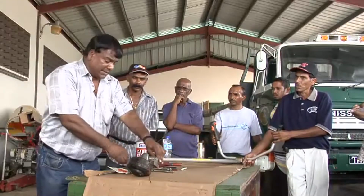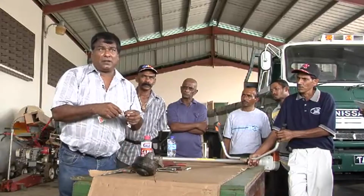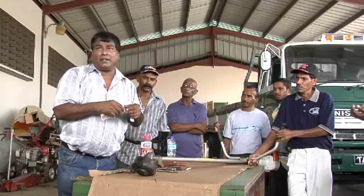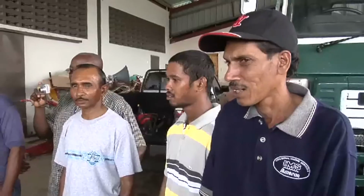The important thing here is the type of grease that you use should be lithium based. Yeah, lithium based, because of the type of gear that you have here, lithium gives you the kind of protection that you need. Multipurpose grease would not do.